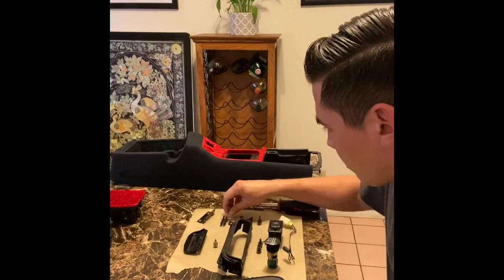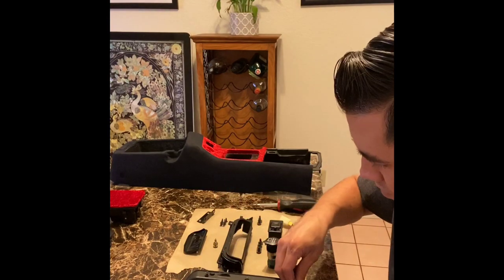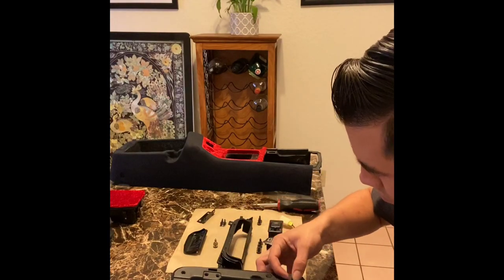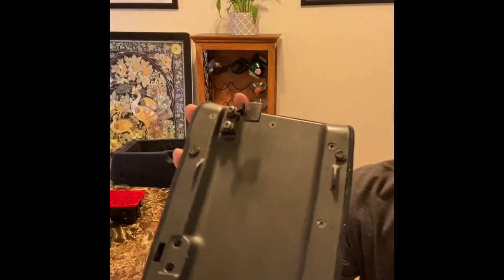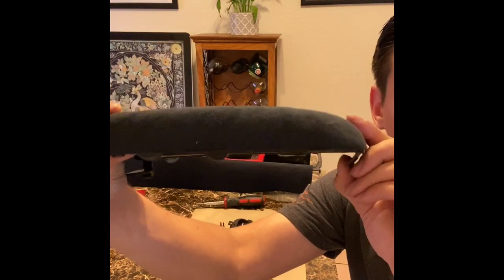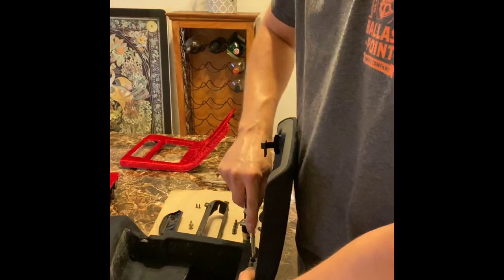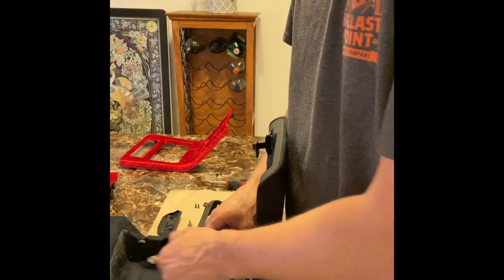The assembly process is pretty straightforward. We'll just be doing everything in reverse order that we have taken it off. I am here starting with the lid. The only thing that's going to be a little unique with putting this all back together is since our center console is now covered with material, there was the hinge that attached the lid to the center console. We will need to cut a couple of slits in the top part of that material in order to allow the screws to go through that material into those holes.